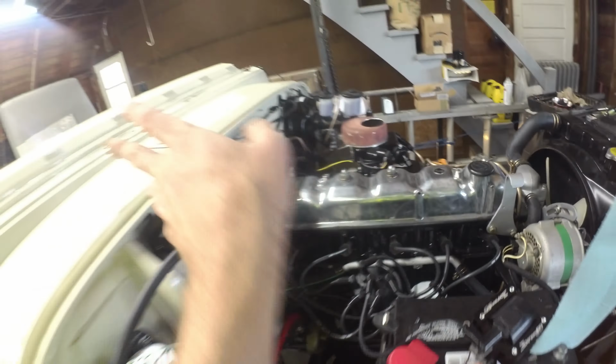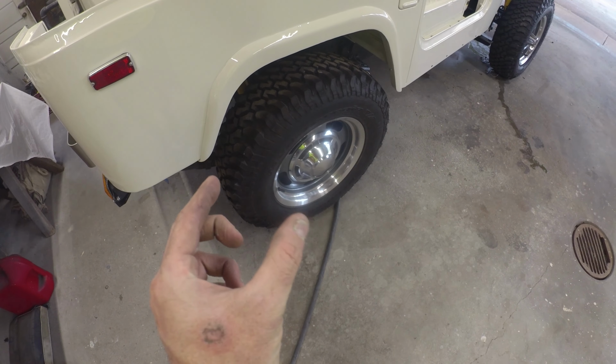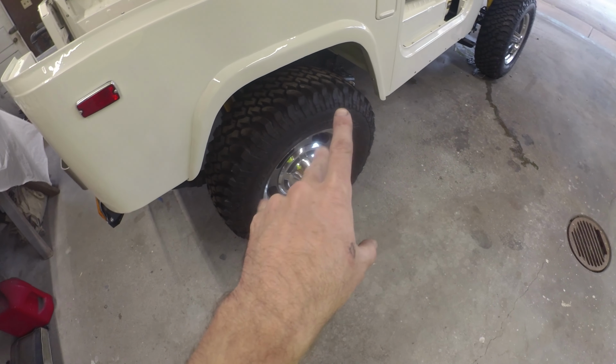Ended up having to redo some brake lines. Along the way, I got some incorrect fittings. There's some that have threads to the end and some that don't. And I got a bunch that were threads to the end that needed to be threads that don't. So I had to pull a few brake lines and get those done, but